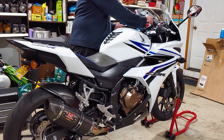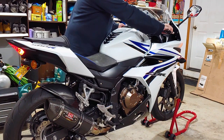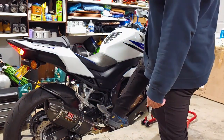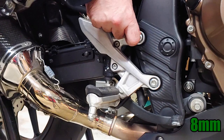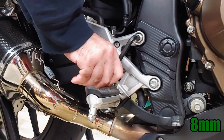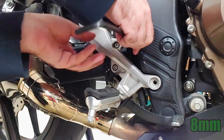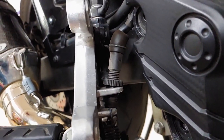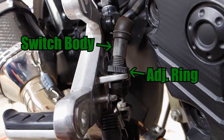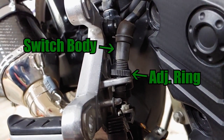While you're testing the brakes, let's make sure the brake light comes on at the right time — it's supposed to turn on just before the brakes engage. The front brake light switch can't be adjusted, so if it's out of sync you'll need to replace any malfunctioning parts. The rear brake light switch is adjustable, but you'll need to remove the right side rear set to access it. Hold the switch body and twist the ring to adjust tension — raising the switch body will make the light come on sooner, and lowering it will make it come on later.